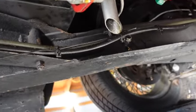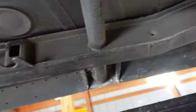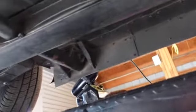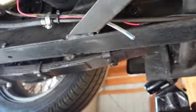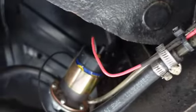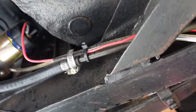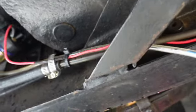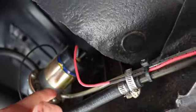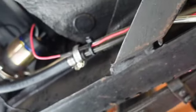Now, one of the main reasons, now I guess I don't know, where do I want to make my crossover? So let's pull this black wire out of here. And this is another reason I use red wire. So there's my SU pump. It's relatively new. Boy, those things are like $400 now. So we're going to clear all this up. If you have to put a breather pipe on this because it's a diaphragm pump, so you got to really keep the mud daubers out of it.